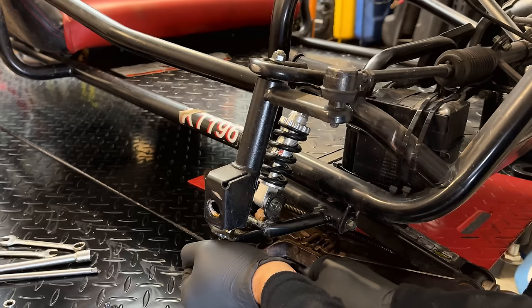And the way this is going to work is that this end connects to the stator output. That is AC coming out. And the other end is going to connect to the starter solenoid where the wire comes up from the battery. So this will always be a live wire. The diode will block it from backfeeding into the stator. But when the engine's running, it'll convert the AC into pulsed DC and charge that battery. So this part is ready to go.